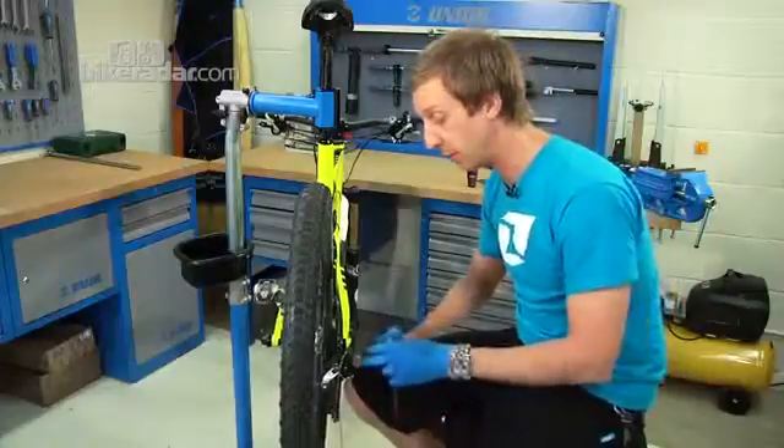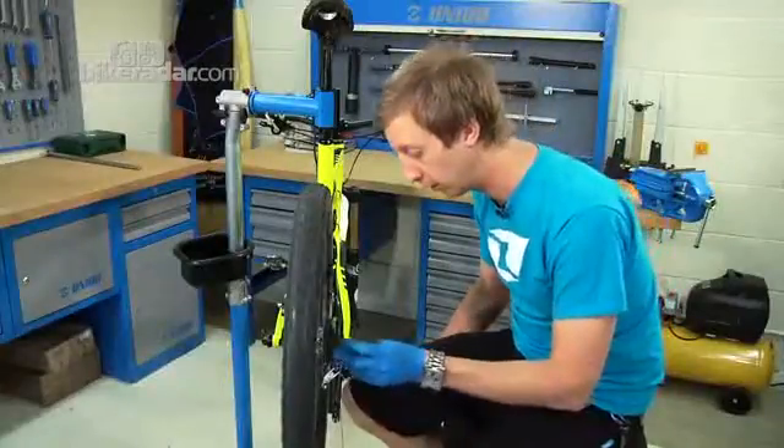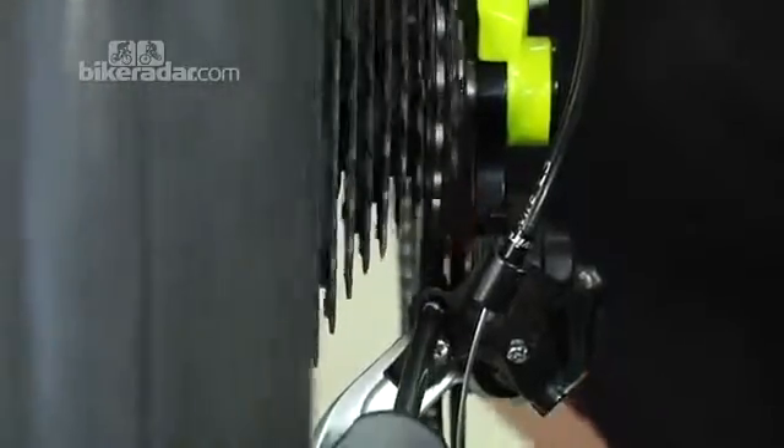As you can see on this bike, it's currently sitting on the second sprocket in, so I need to adjust that screw counter-clockwise in order for the mech to line up properly and the gear to drop down.